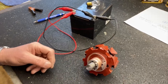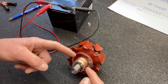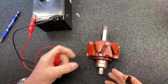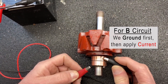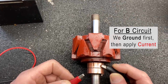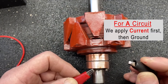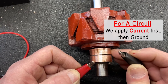Here's a typical rotor out of an alternator, which has got your rotor coil in here and your pole pieces. That rotor coil is hooked to each one of these slip rings. When we energize the rotor, we have to put ground in one spot and then control how much current it gets — that's B circuit, because we're controlling the current before it charges the coil. The opposite way, putting positive current in and then giving it ground, is A circuit.